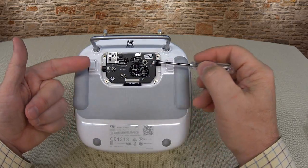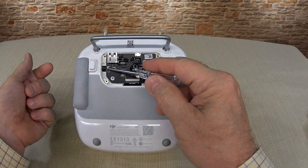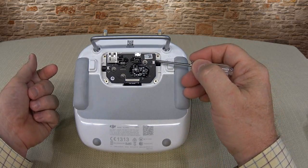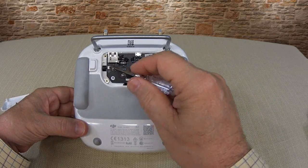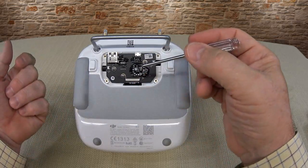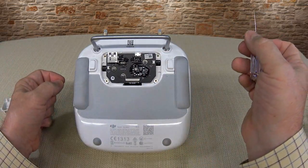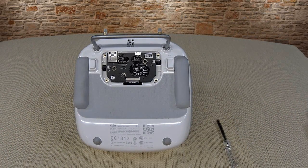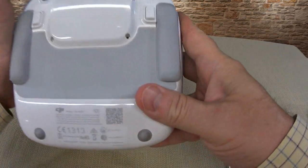With these 2 guys, you can feel them seat when they go in, but if you want to check, there's a white line on the cable that runs again against that edge there, and the same thing up here. Once they're in, you want to make sure that these are flipped fully down, because remember I described earlier, when they're down, they're actually making a connection to the cable, a nice and tight connection. So everything in there looks really good to me. I put the 3 screws in to hold the printed circuit board down. Then the last thing we've got to do is put this cover on, which is again a pretty straightforward operation. You just seat the cover like this, and once it's in, you put the 4 screws in it.